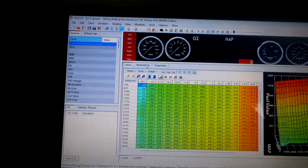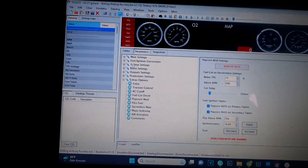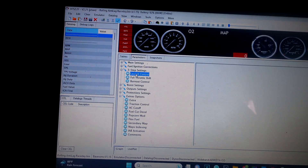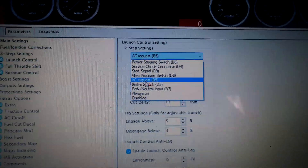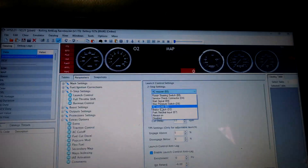In the map we're going to head over to Parameters, go to Three Step Settings, Launch Control, and we're going to use the AC request — that's a ground. We'll be able to wire a ground into that. If you're going to be doing a ground to the B5, that would be right up here, so pretty much in the middle plug, one two three from the left on the top — that's going into the actual P28.